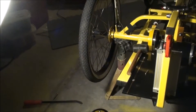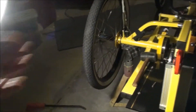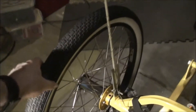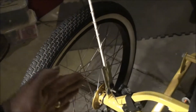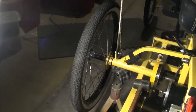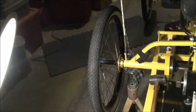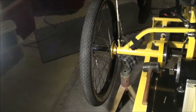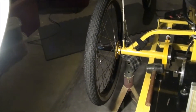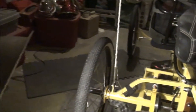If I have chafing, then that's what probably was the problem, so we'll need to fix it and reroute the wires a little bit better. That's the only thing I can do. I did everything else I could possibly think of. All the wiring checks out. So the chain will be here today. I took this sprocket off and I'm adjusting the axle a little bit — it was a little loose, about a quarter inch of play. I didn't tighten up the collar tight enough. I'm also having a tough time with this brake drum.